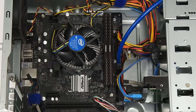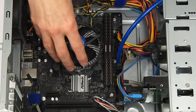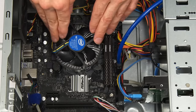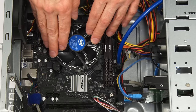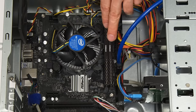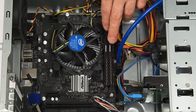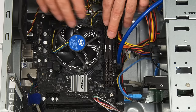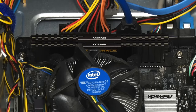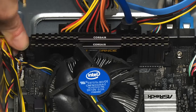Having taken great care to ensure we've got a compatible new CPU, it's now time to fit it. This is basically a four-stage process: removing the cooler, taking out the old CPU, fitting the new CPU, and putting back a cooler — in this case the new cooler, which is identical to the old one. Before doing that, I'm also going to take out the RAM, which isn't essential but because the RAM is very close to the cooler, it'll give us a bit more space to work with. Let's release the clips on the DIMM modules and lift them out.